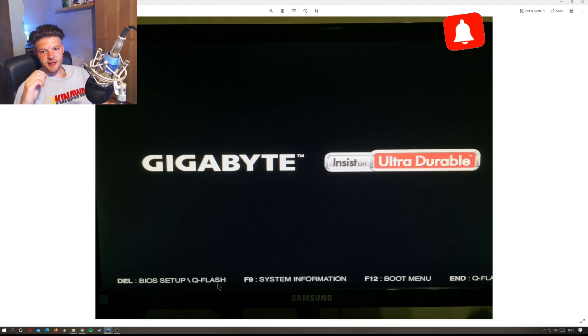One option: press the power button, let it boot to the POST screen, then hold the power button until the computer turns off again, wait 10 seconds, and try rebooting — it might boot you into the second BIOS. What worked for me, and seems to work for most Gigabyte boards, is to press and hold both the power and reset buttons on your case simultaneously for around 10 seconds. Let go — the screen will go black for about 10 seconds — and it should come back on and boot you into BIOS where you can set your boot drive and other settings.